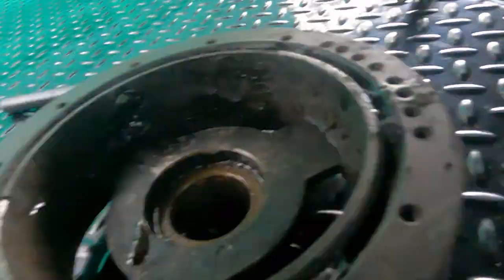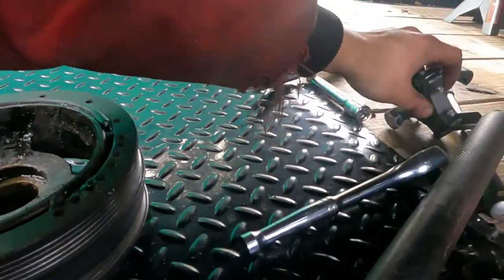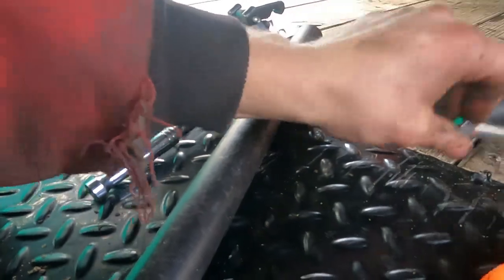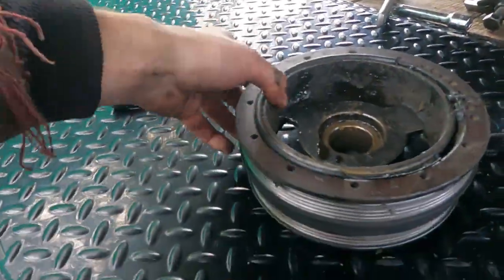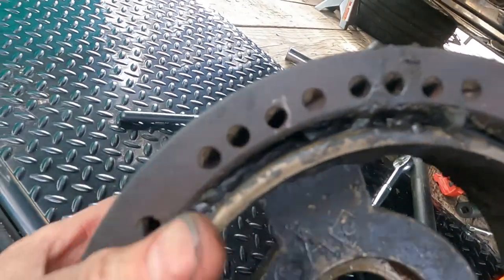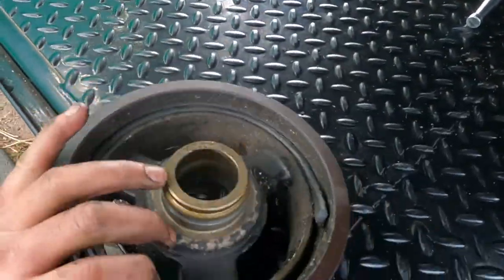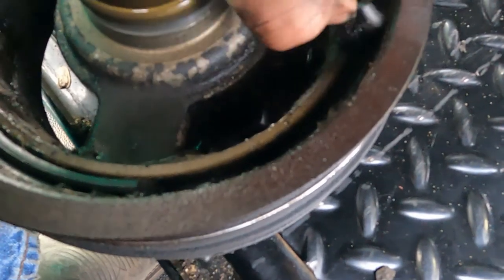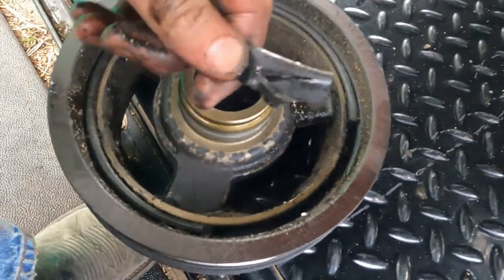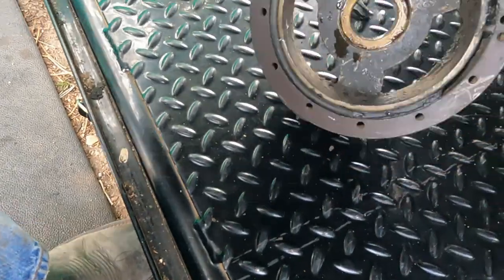Just to give you guys a better view — the puller claws onto there and then we just have a little extension sticking in there to spin on. This is why I said the balancer's bad. Now I can get a close-up view and it looks like the middle rubber ring in there started to just melt away, and on the back side — which we could not see — it just started to rip. Definitely bad. Gonna make for a cool trophy maybe.